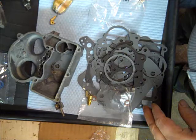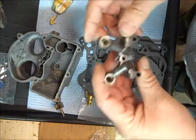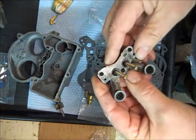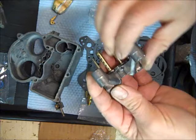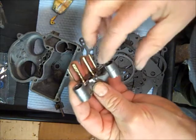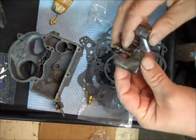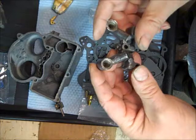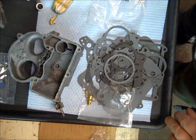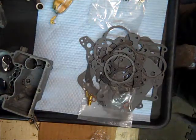As far as cleaning, I use ultrasonics, which is probably different from your process, so I won't go through that too much. One thing I make sure of is that all these little passageways are clear — whether you blow through them or whatever, just make sure they're not stopped up. Especially these two right here: when you use your accelerator and pump gas through it, it comes out through these two little holes. If one of them is plugged up, it's only going to go into one side of your carburetor. Make sure everything is open and clean before you get started. That's basically it for this part — we'll go to part two for the actual rebuilding. Thank you for watching.